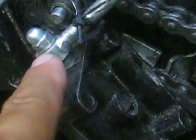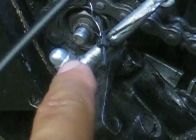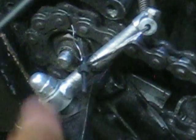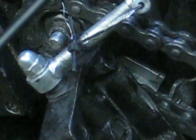Before you take the camshaft out of the crank arm, be careful of one very important thing: make sure you mark it with a pencil, a marker, or take a picture — note where the crank arm is in relation to the camshaft. You need to put them back in the right position, otherwise the crank arm will be in the wrong place and you won't be able to use your cable. The whole repair should take no more than 15 minutes.